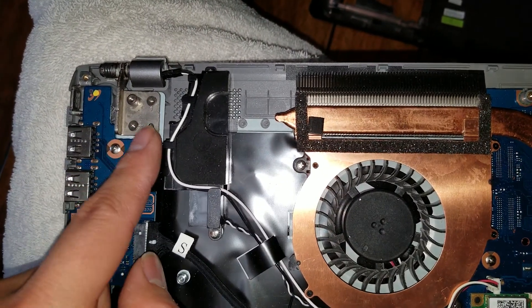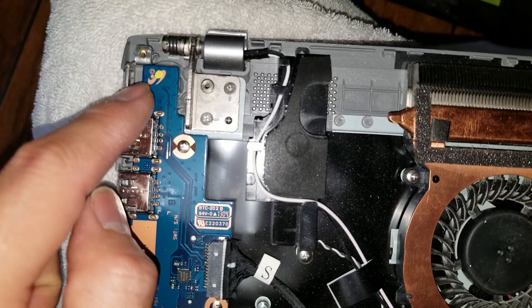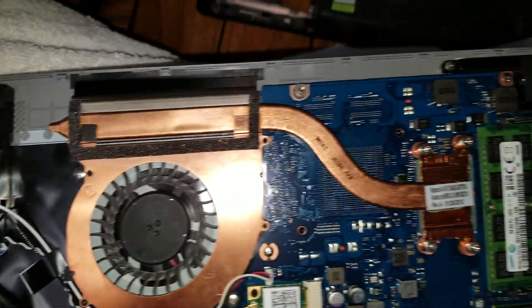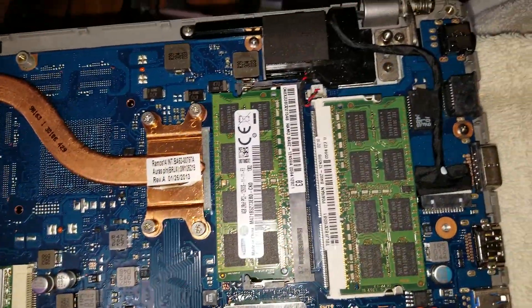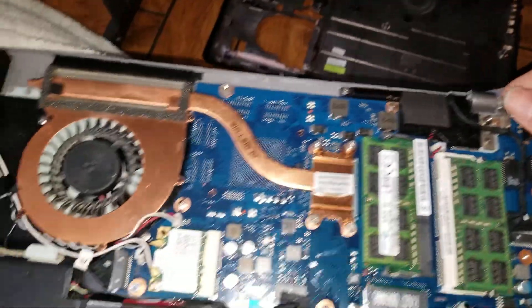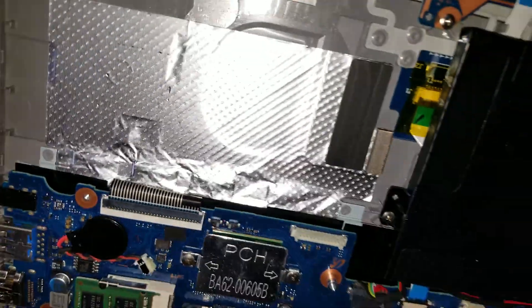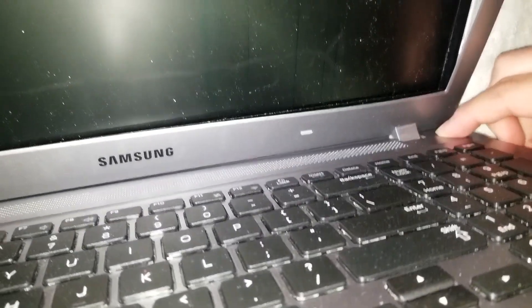If you need to remove the whole assembly, you can take these out. You'd have to take out this USB port because there's most likely a screw holding this lock mechanism in here. The CPU is soldered to the board, just like all the other new ones — the rest is all on one board. Once you disconnect the battery, hold the power button to drain any excess power.